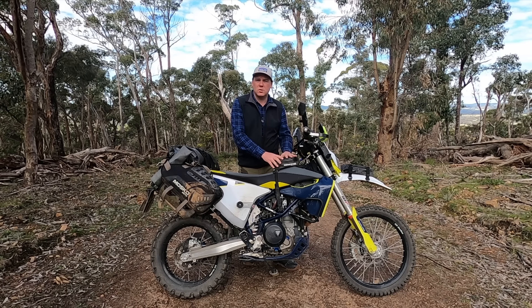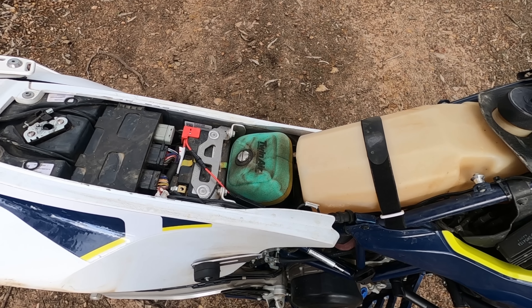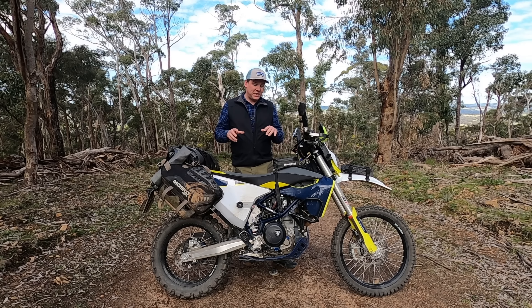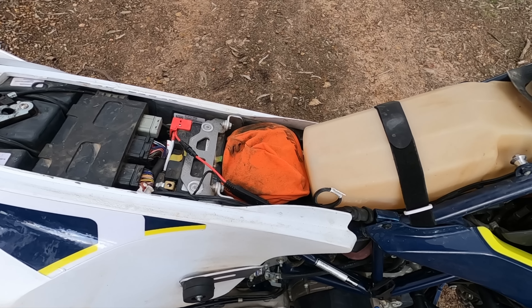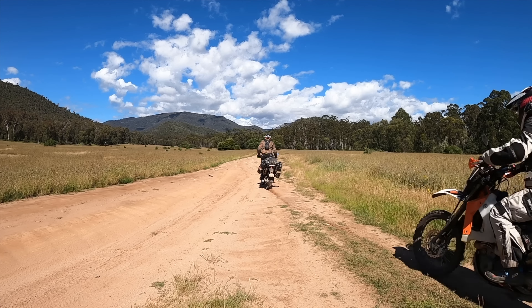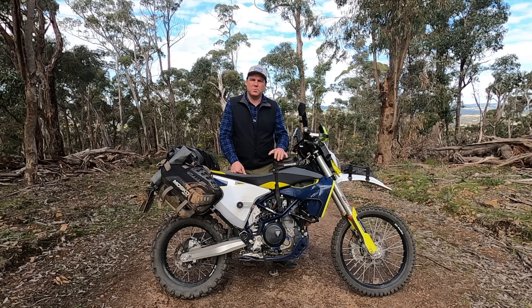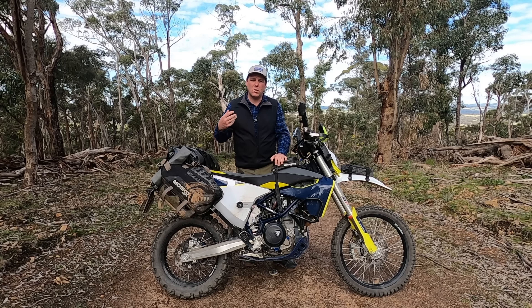With the auxiliary fuel tank installed, you obviously have to remove the factory air box — Ray Garage supply that air box for you. I also like to put a Twin Air sock over the top of that foam filter; I've found it helps keep the dust out. We have so much dust here in Australia, and it extends the longevity of that foam filter on big trips. I also carry a spare filter that packs down really small — I chuck it in my kit and can simply change it out midway through a long haul trip.